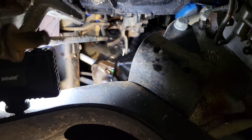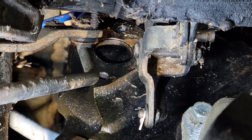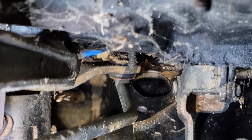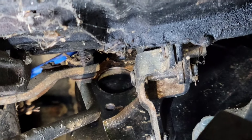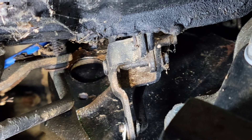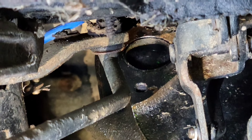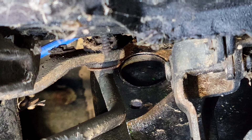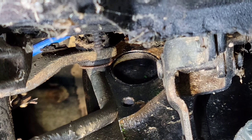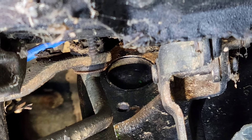It's coming up above — that freeze plug right there. I'm trying to keep from rotating my phone around. Right up there is a freeze plug, and if you can see the little indentation divots, there's one that's green to the bottom right of that freeze plug. That right there, my friends, is from someone installing the freeze plug with something pointy. I wiped and cleaned this all off.